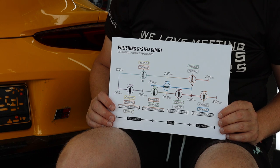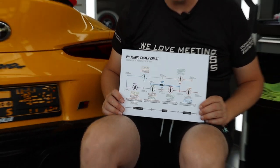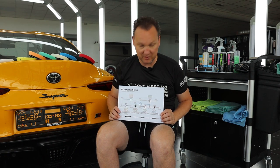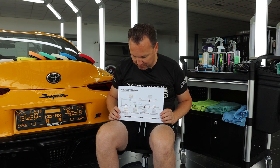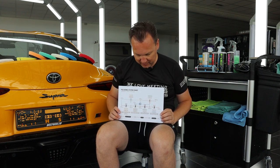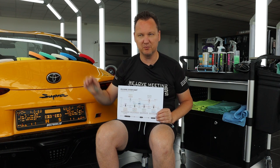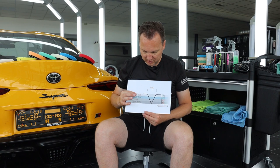We're working with water-based polishes here, which means they will not cover up or mask defects. They will probably dust a little bit more than oil- or petroleum-based polishes in the stronger segments, but that's just how these products are designed. With this infographic, when you look at your own car's paint you can easily understand that if you see swirls they're around 2000–2500 grit, and if you see deep scratches still in the clear coat or color coat, they are sandable or polishable.